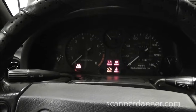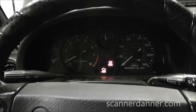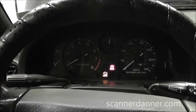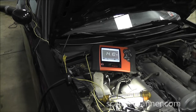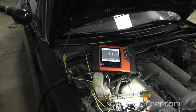We have the new fuse installed. Turning the key on — you notice we have dash lights that we didn't have before. I'm going to start the car and watch our tach — the tach is operating now. We do have a check engine light on this vehicle, something else that will need to be looked at. Turn signals work. Let's go under the hood and see what our charging system voltage is. I'm reading 14 volts — that is a fix as far as the charging system goes. That fuse blowing is why this thing died on him, though of course something caused that fuse to blow.